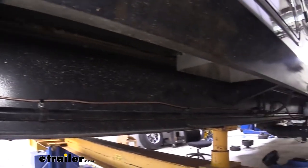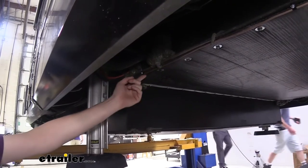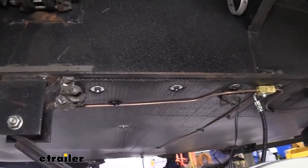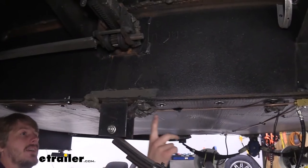We follow all the way down to the back of the frame. Once we get to the back of the frame on the side, we go to the bottom of the I-beam and secure it along that all the way until we get to where our first axle is. Once we get there we put a little 90-degree bend to get around the hanger and then 90 it back.